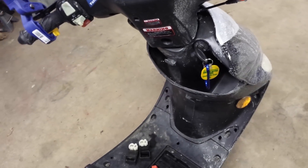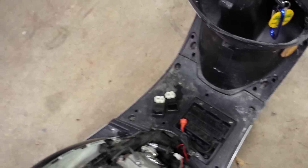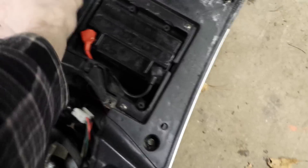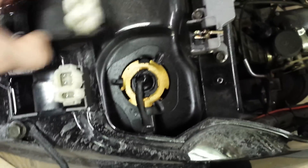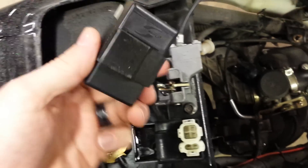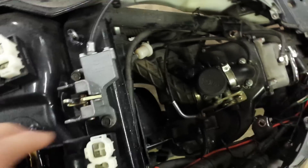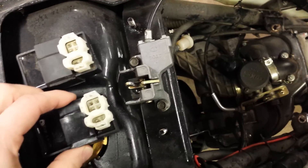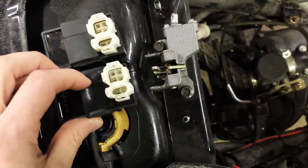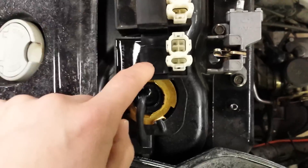I did not go on the internet and look up a Malibu Propel scooter six-pin CDI box — I just looked up 'six-pin CDI box.' I'll show you, I got the old one and the new one here, they're literally identical. I ordered mine from eBay, it was like eight bucks. The old one has some identifying numbers on it, but everything online says just make sure you look at the pictures, make sure it lines up accordingly. That's what I did — I took the old one in the house, ordered this one online, and that's what I got.